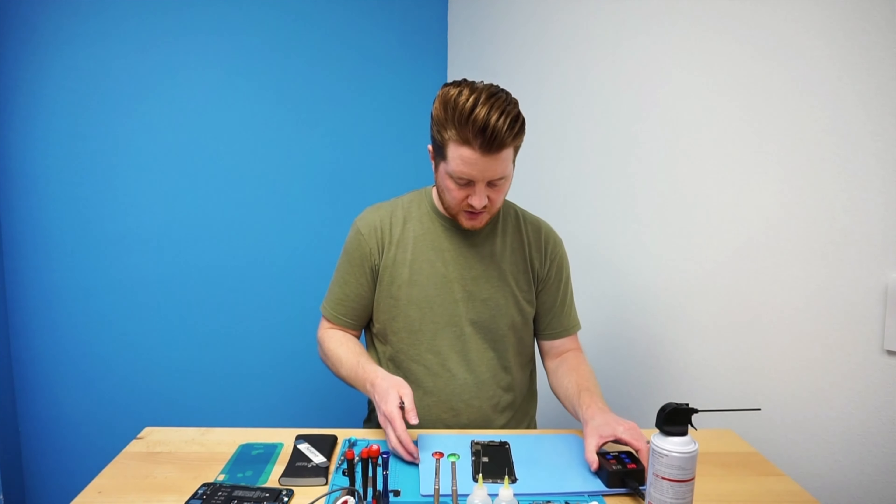We're going to take these pentalobe screws and insert them into the bottom of the phone. Whenever you're inserting your pentalobe screws, make sure you apply quite a bit of inward pressure from the screwdriver itself — you don't want to strip these screws because they're very easy to strip. Use a good screwdriver like the 2UUL or the Wiha, like I showed in the video, and they bite very well into the top of the screw head. Now we have an iPhone 11 Pro Max that we need to do a little bit more testing on, but as far as the touch, everything looks like it's functioning well and it didn't give us any kind of Face ID errors — which is pretty cool considering the absolute catastrophic damage to this one. I appreciate you watching the video and I hope you can take some of these tips and tricks and apply them to your next iPhone 11 Pro Max repair. Everything you see in this video is linked in the description below, so be sure to check all of that out. Don't forget to like this video and subscribe. Appreciate y'all following along — I'll catch you in the next video. See y'all later.